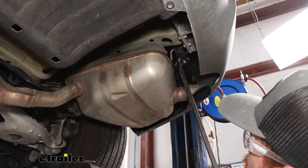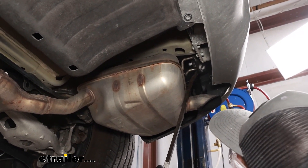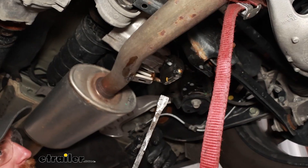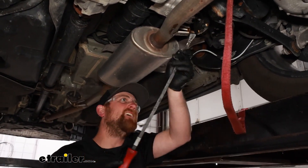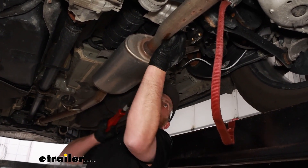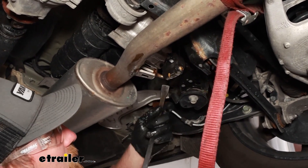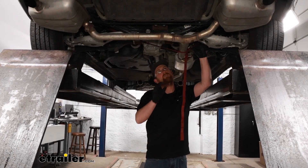To get these off, you can lubricate them with some soapy water and take a pry bar, big screwdriver, whatever you've got, and work that end off. Then do the same thing for the driver side muffler. If you continue to follow the exhaust towards the front of the car, here's that third one. With these it doesn't really matter what end you work off — whatever one's easier to get to. These ones are a little trickier to pop off because you don't have a great point to pry on, but no big deal. With all three off, you should be able to loosen up the strap and let the exhaust come down a little ways.